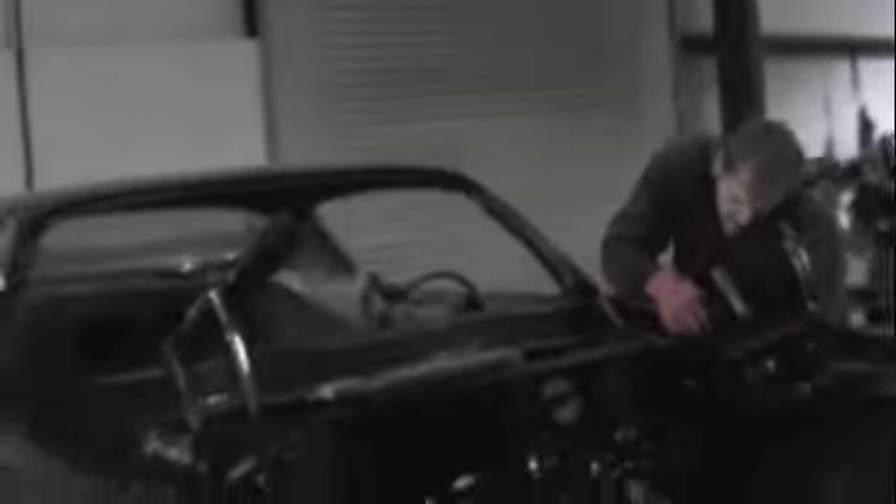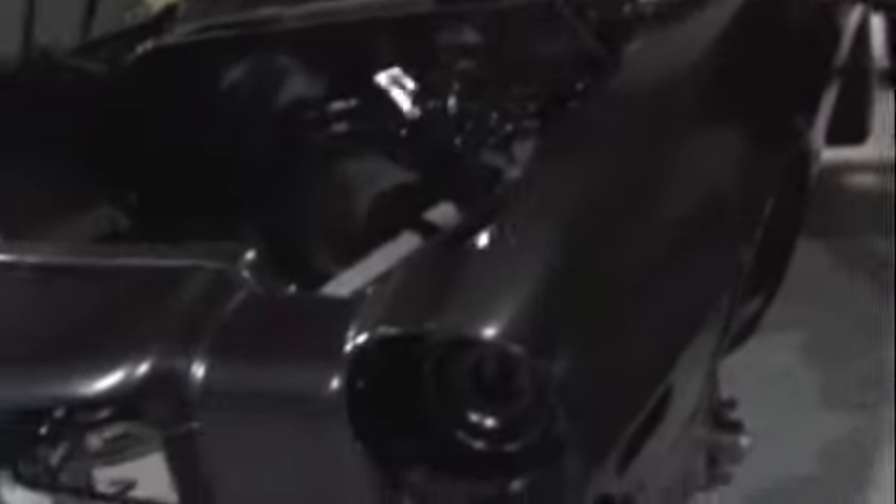The same with the other side — we wanted to bring it back enough that we could end up touching. Now you can move this back and it really sets the gap where we need to have it. We'll be able to adjust the top of that fender and the lip. Simple minor adjustments — it was just a bunch of disassembly, it'll be a bunch of reassembly. Then we'll work on some of the waves on the front end. Like I said, you end up with good metal but you have to do some tweaking and adjustment with aftermarket parts.